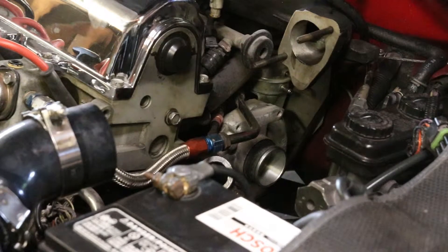Alright, just a little bit of work there — we've got the throttle body off, upper and lower intercooler hose, and the air inlet to the turbo off, so we've essentially got an exposed turbo back there. You can see the coolant feed line coming off the turbo and behind that the oil feed line. We're going to go ahead and get those lines off. We've got some old school stuff happening here — used some chrome tube to do that — but it's got to go because it's VNT specific. The oil feed line is going to be interesting down at the oil distribution block, and the coolant feed line to the heater core has to come off too.